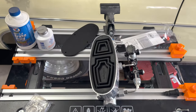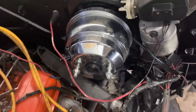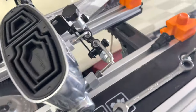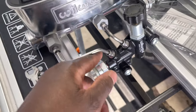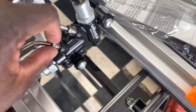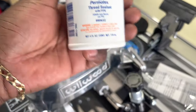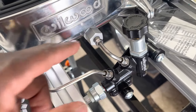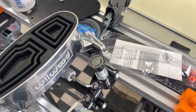Back with another one here in a '66 Impala. This is the Wilwood master cylinder, and on a prior video you can see I finally got the brake booster installed. Today it's pretty much just brake bleeding and installation of the master cylinder. The proportional valve, the lines, everything came separate in the box but I kind of just hand fitted everything. Before I tighten everything, I got some Permatex thread sealing which I'm going to use just to dab a little on the threads for a nice seal.